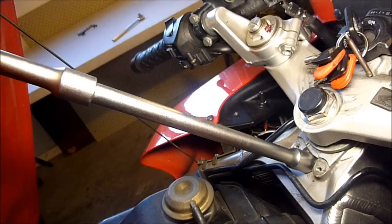I'm not going to tell you how to lift your tank up — that should be pretty obvious. Two screws there, make sure your seat's off first, prop it up. I'm using just a couple of extension bars from my socket set, but you can use the chain adjuster tool that's in your tool kit, which is in the back of the bike. If you do use that, it clips into the holes up here — that's where it ends up holding up the tank.